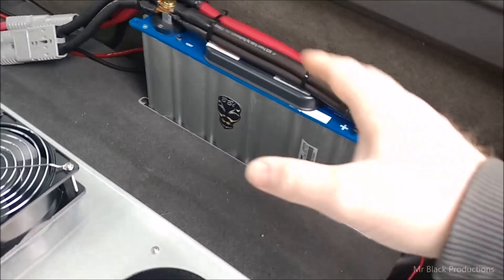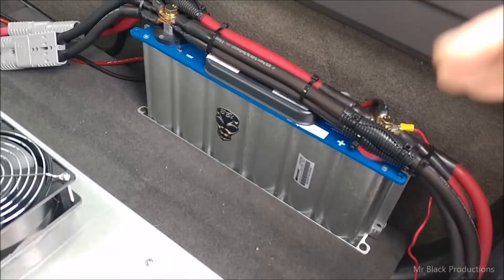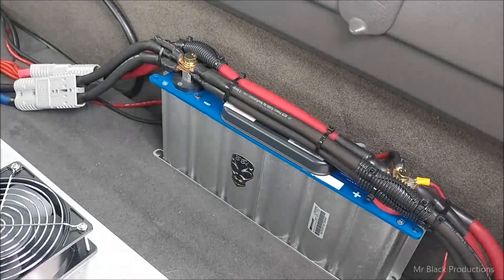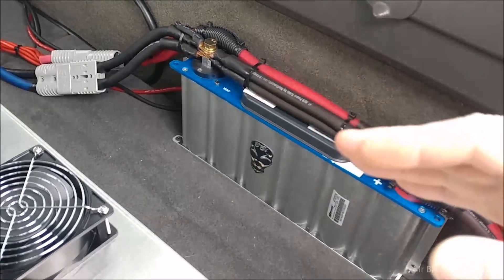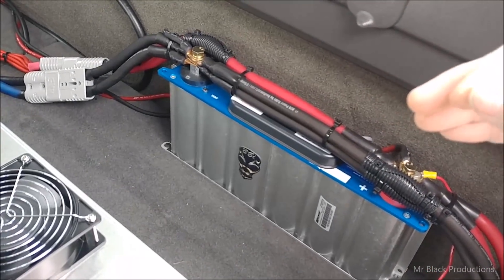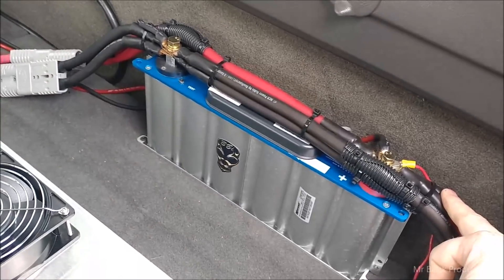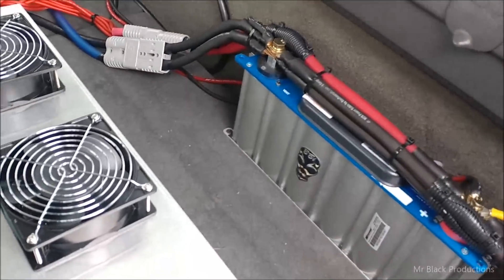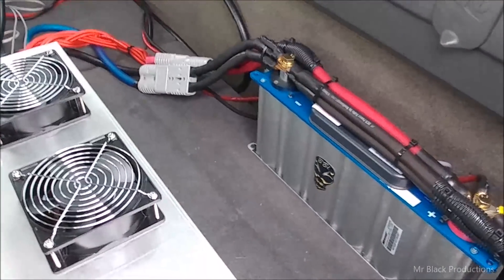Actually, this truck — because the way it's set up now as an add-on on our test platform — you'd want to go down to just one battery and have multiple supercapacitors. If you think about how a battery and an alternator work, the alternator pushes up on the charge curve. When the voltage drops down to a low 12.5, that's when you're running on battery storage. Up until that point you're running off the alternator. So the more batteries you have, they actually pull amperage away from the alternator's ability to charge the supercapacitor, which is your most important thing. You have your positive rails that come in, and then the positive rails that go out — the very last thing that touches anything before it hits the amplifiers is the supercapacitor. Put your supercapacitor as close to your load as you possibly can.